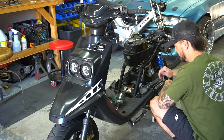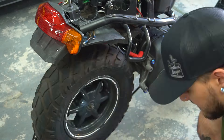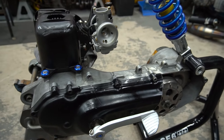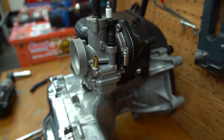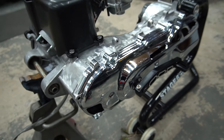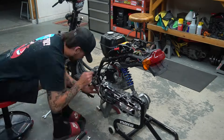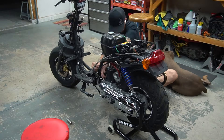We got to get this motor out of this bike, so I'm going to start stripping this bike down. We are going over the top with stripping it down, but it's simply because there was an issue before I went on the trip with this exact bike that was almost acting as a ground issue, so I wanted to pull not only the stuff off the engine but all the plastics off so I can examine the wire harness. We unbolted everything, got the motor sitting there on the stand. This is the motor we had previously in here, and here is the fresh giveaway engine that we're going to be firing up and dialing in. Both of these vertical Minarelli engines are Stage 6 Sport Pros and have pretty identical setups. We got the giveaway engine sitting on the stand ready to drop the chassis onto the engine, and it actually worked out pretty well and pretty easy to do by yourself — slapped everything back on, the wheel, the pipe, plugged everything in, and got this thing ready to fire up.